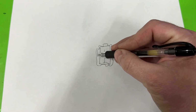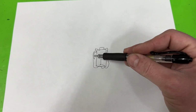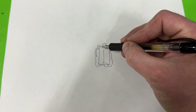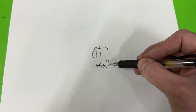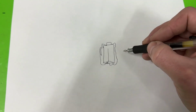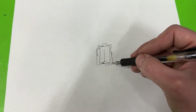and that's about how it looked. I mean, I'm doing a bad drawing, but so did he. As bad as my lines looked, that's as bad as the port match looked. So at some points, like maybe through here, it was matching the port of the head. But for the majority of the parts, it wasn't, and it wasn't uniform. So it wasn't like it was only larger on one side or the other. No, it was non-uniform. It was everywhere different.